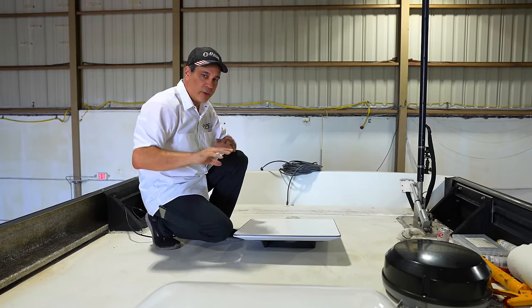We've got the line run from downstairs — we went down through the cap into the cabinet, up to the rear. I want to show where the Gen 2 version is going to go. We have a mount coming that makes this more of a flat mount — it'll be kind of flat, won't be more than this high off the deck. The pole comes off the back here, gets modified just a bit. You can see the front one going one way and this one going the other. The wires will be Dicored along the edge, kept about an inch off the ground so water can roll through and it's not a trip hazard, then attached and running all the way down the coach underneath.